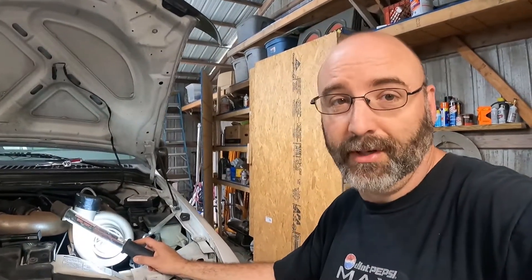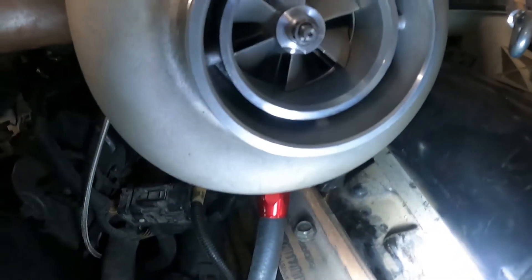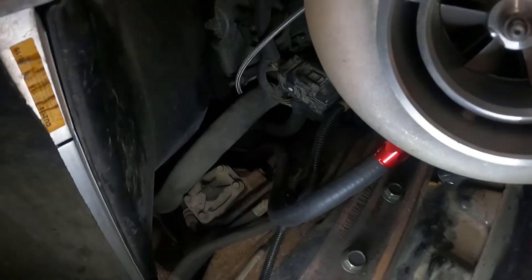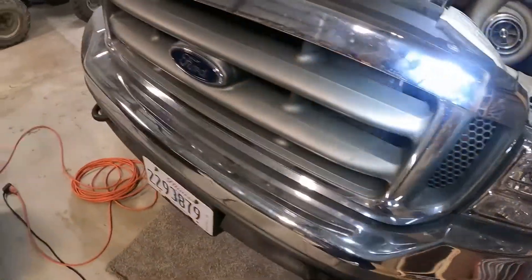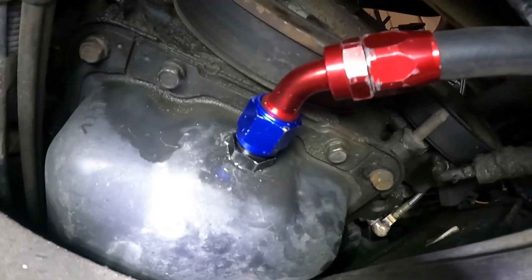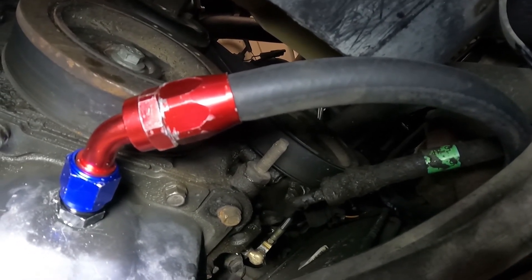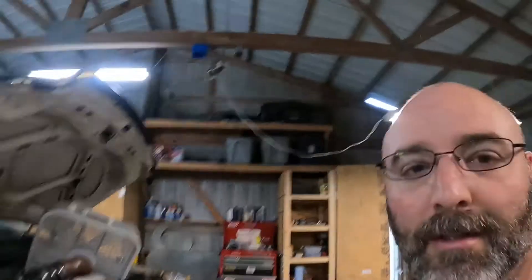It turns out I did have some 5/8 hose laying around that'll work on this dash 10 fitting. There's the hose running down there. We're going to have to put some extra piece of pipe there so it doesn't rub a hole in it. There's the 3/8 to dash 10 adapter on the oil pan, then a 45-degree bend, and that black hose goes straight up to the oil drain on the turbocharger. That pretty well takes care of the oiling system. So we just went through that whole mess of oil hoses, oil lines, and fittings. Next time I think we might check out the massive exhaust tubing we're going to need. Catch you next time.